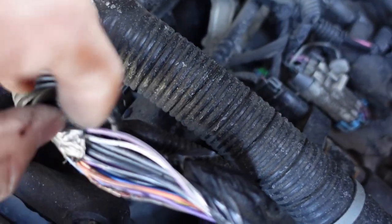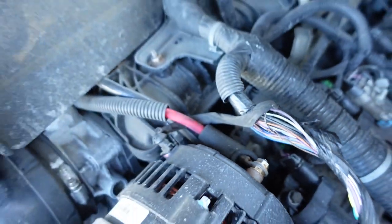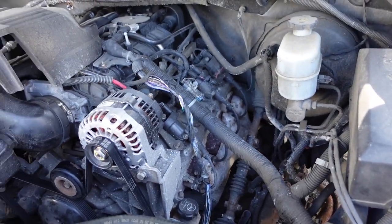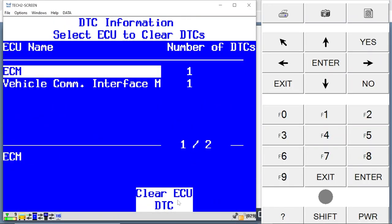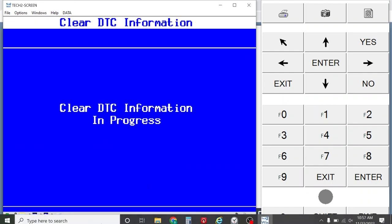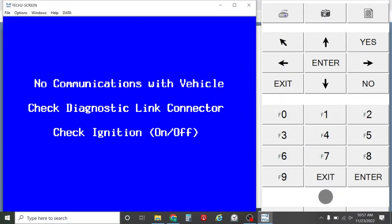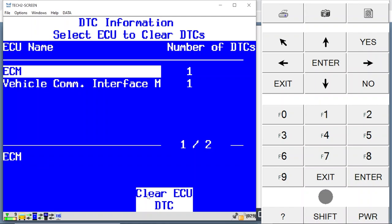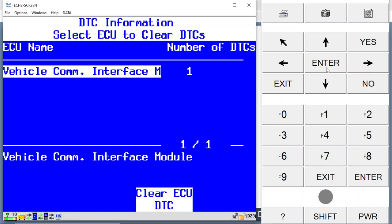Our circuit's still intact. I'm going to start this thing up — it looks like it's only one wire. I'm thinking to start it up and check if we have a signal again. They really need to get a cap for that alternator stud. Let's go back to the scan tool. I'm going to clear the code — let's clear both of these out. I'll clear the ECM code and go back to that camshaft data PID, camshaft RPM signal, and see what goes on. That code's cleared.